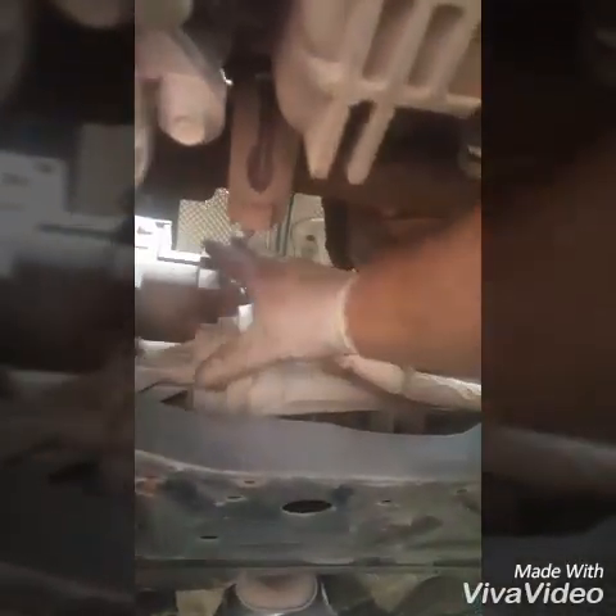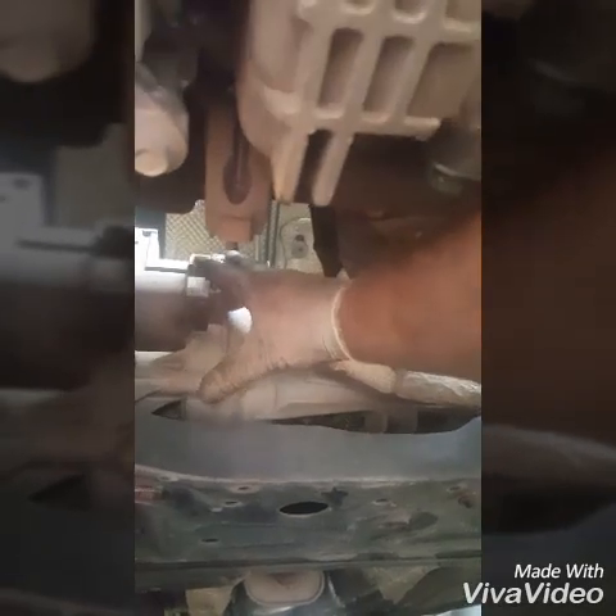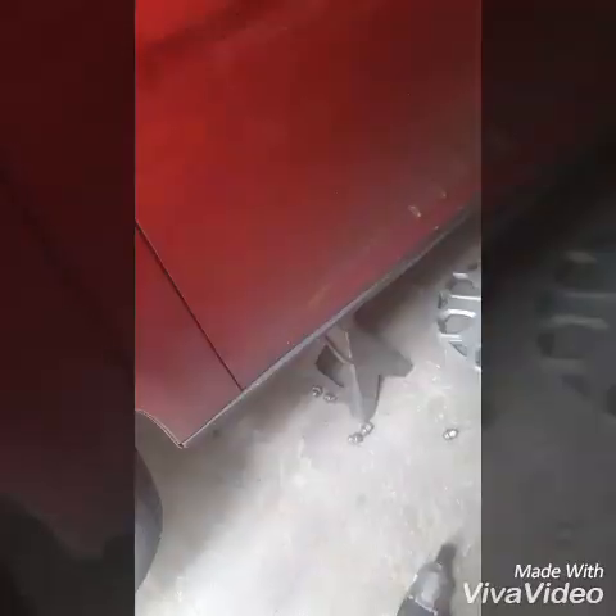What goes on with these is this electric motor right here fails — some kind of wiring problem inside from what I've seen online. We're going to have to take this whole subframe off to get this rack and pinion out of here, because of how big this unit is. The electric motor won't fit through either end.